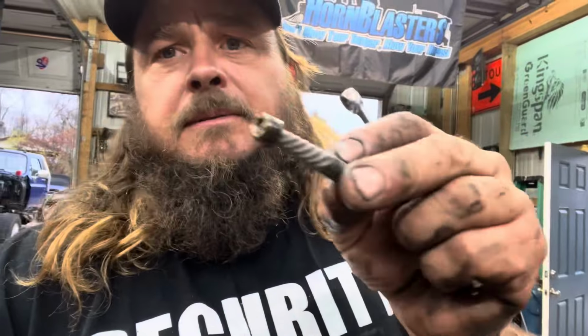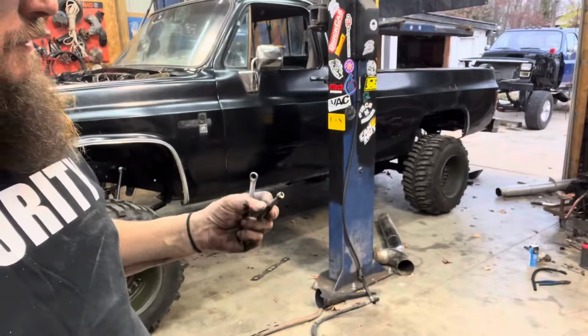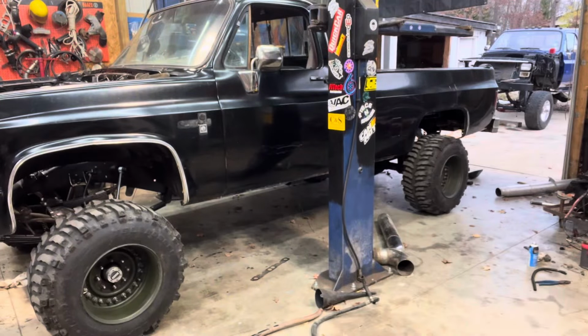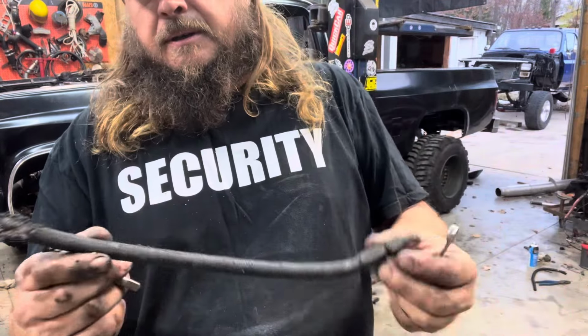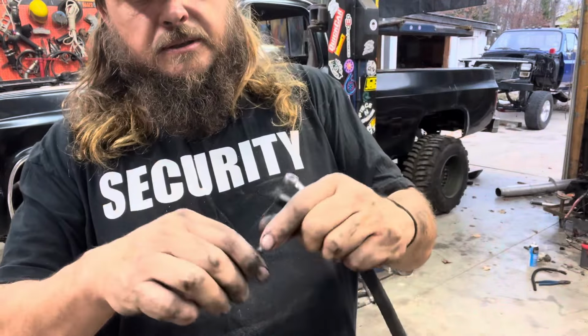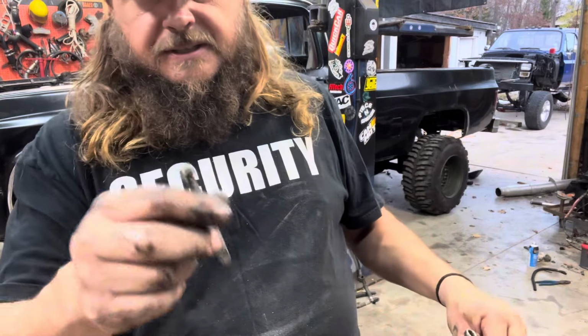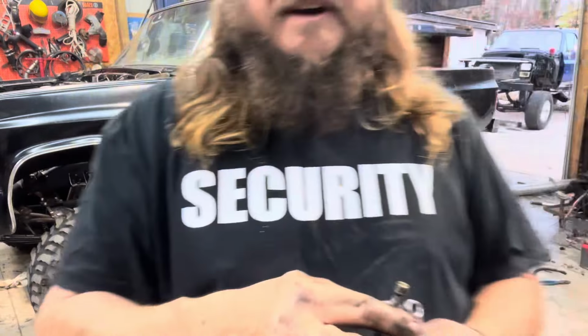All right. Will it start? Free Cummins. Yes, it did. Did it puke all of its oil out on the floor? Yes, it did. Broken fitting. For some reason there was a hose that goes to something. I'm not sure what yet. But this braided line right here went into the block and was broke off and was leaking like crazy. So if I replace that with a plug, I should be able to fire it back up.